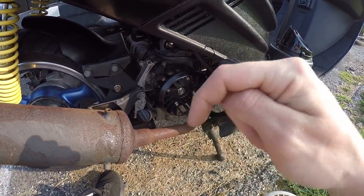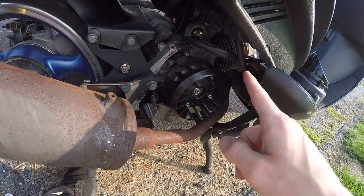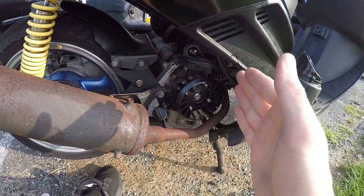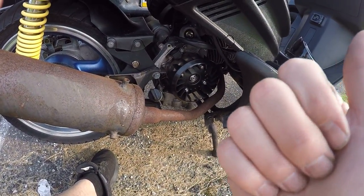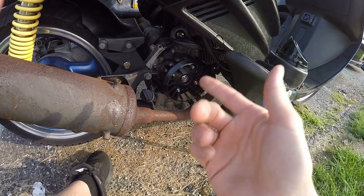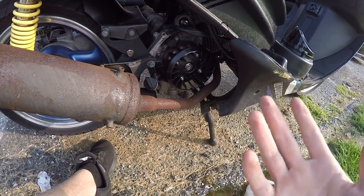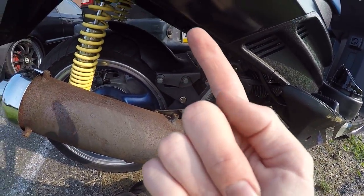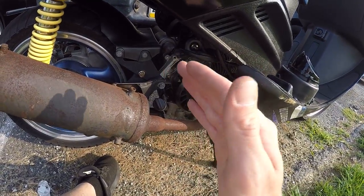I will link this in the description below and I'll keep you guys updated on the build process. So with the Gloxel top end — the Gloxel is just the OEM 150 rebuild, it's not a 160, it's not a 170, just an OEM rebuild, I think it has like an A9 cam, that's about it. But the thing I got is literally a whole package — it's the forged piston, high-flow heads, it has the cam package. I even opted for the best carb you could have, the cool see-through carb bowl so you can see the fuel. I'll have a see-through glass fuel filter and see-through line, so I'll be able to see the whole fuel setup if I need to check whether it's actually getting fuel.